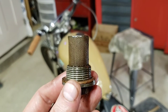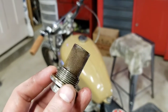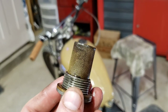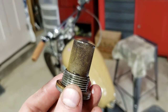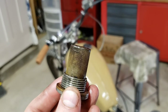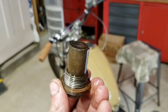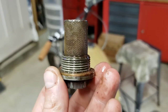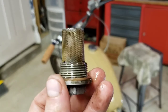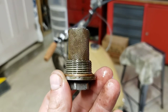Here is what that filter looks like. It's very similar to the bolt filter mechanism, obviously a lot skinnier than the one in the oil tank. You want to clean that off real good, check it for debris — this one actually looks really good. When your bike is draining, it has to be as level as possible, and make sure you leave the cap off the top of your oil tank so it can clear out. Give it a good 10 or 15 minutes so anything stuck on the bottom can drain out. When putting the bolt back in, sometimes the brass washers can be damaged — if they are, you definitely want to replace them, because there is a lot of pressure on this part of the motor.